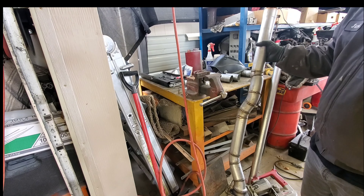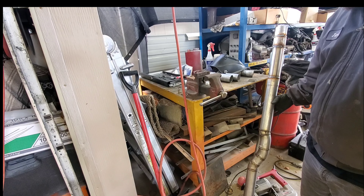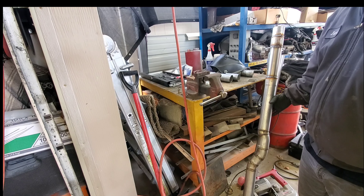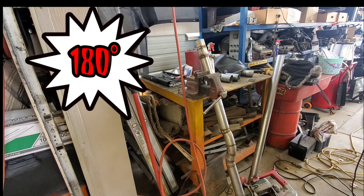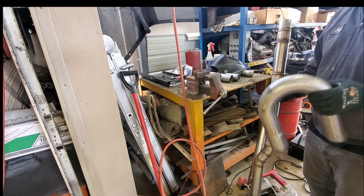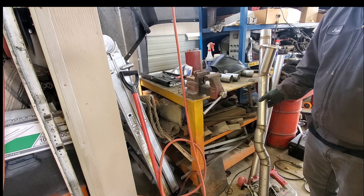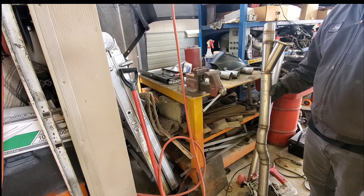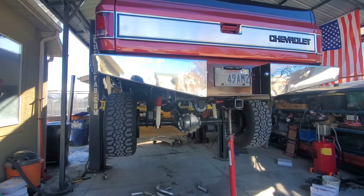Alright guys, that is the pipe to the muffler - what do you guys think? Got a lot of bends. I don't have the ability to bend this but the universal kit works great, just cutting little pieces. The main piece I used for all of these bends is just one 90-degree piece - I got all these bends out of that 90 degree by flipping them around and flip-flopping them. Pretty cool, I'm stoked about it. I'm gonna get it bolted up in the truck, get the muffler tacked in, and then hang some hangers.